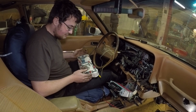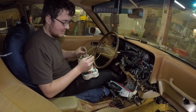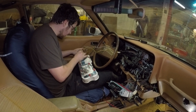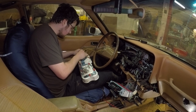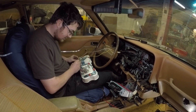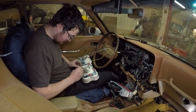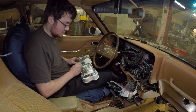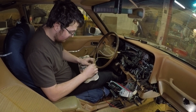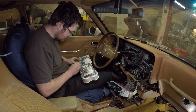With the cluster out, we're checking the lamps work. I've wired up the original dash lighting feed and I'm probing the lights — some of them do actually come on and work. But obviously if you light one they should all come on because they're all part of the same circuit. So far it's mostly been unsuccessful — a couple have come on but the majority haven't. Some of these are also indicator lights — I'll test them as well. That one does, that one does, that one does. This one doesn't — oh no it does, just got dodgy connections.